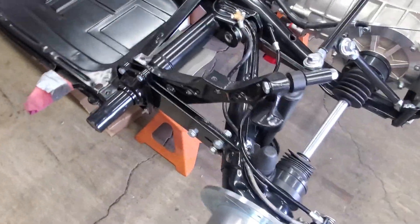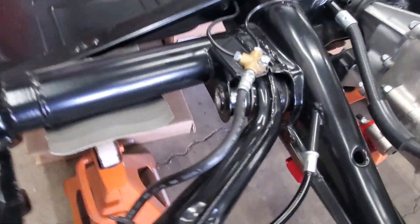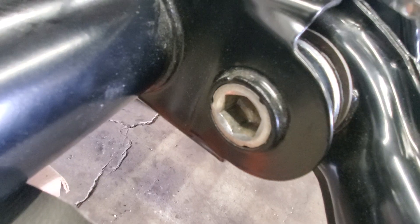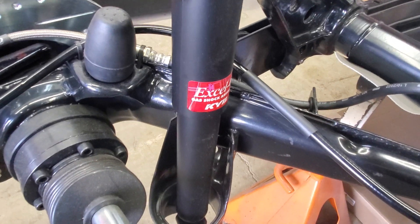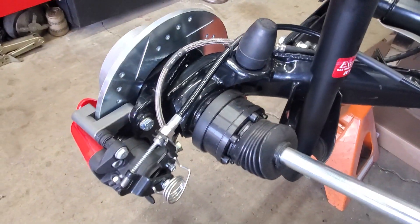At the back of the car, everything is painted and/or powder coated nicely. Even the hardware for the pivots is all freshly zinc plated — this is original VW hardware — along with new shock hardware. The new shocks are also from our friends at Air Cooled Vintage Works; these are KYB gas shocks, so it should give the car a really nice ride.